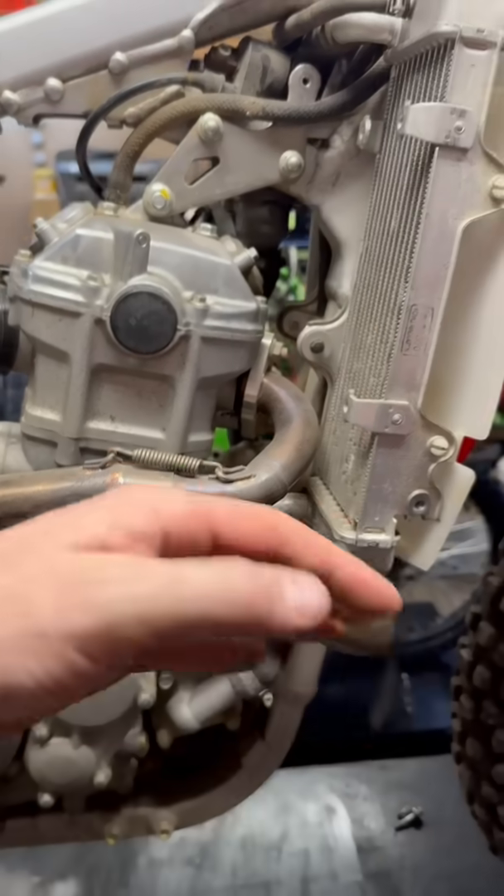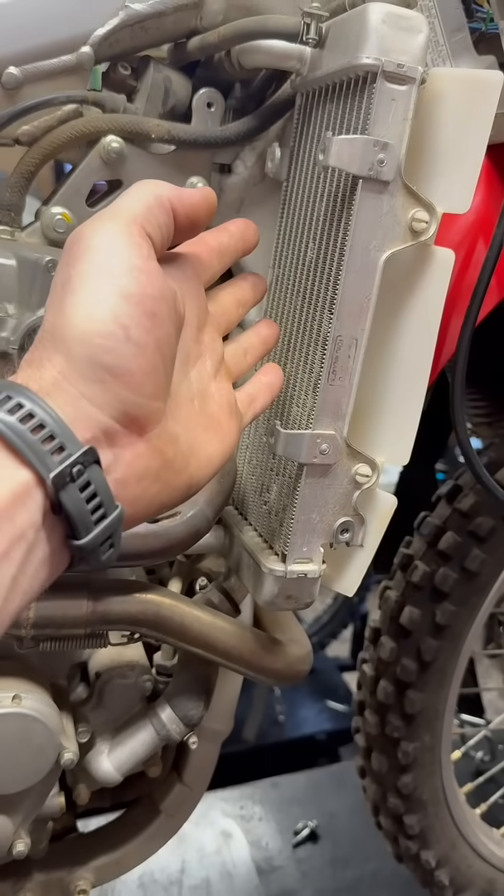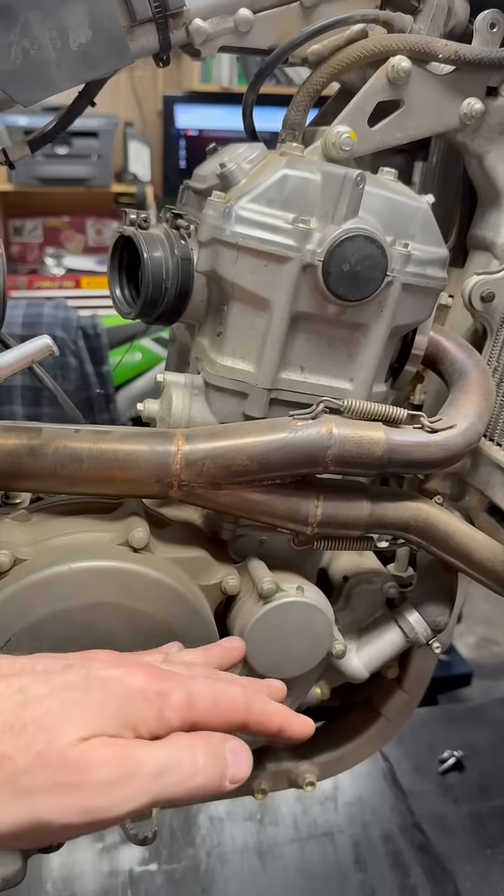One of the issues more common on older dry sump engines was that the oil would leak from the tank into the motor — that's called wet sumping a motor. In modern dry sump engines, the most important thing to remember is when you're changing the oil, you need to have the bike running for a while before you check the oil. It's quite common on these that the oil level appears too high because somebody changed their oil, didn't know that, and set the oil level before the bike had actually run.